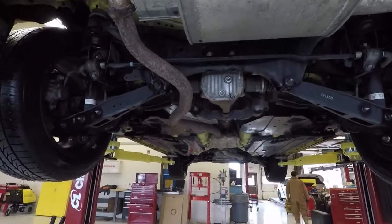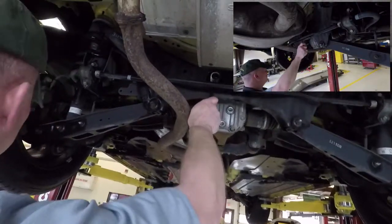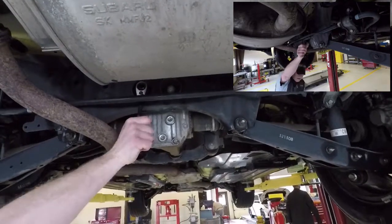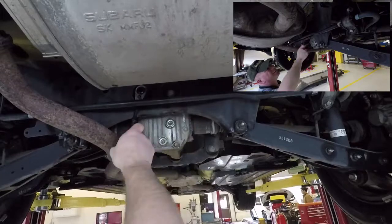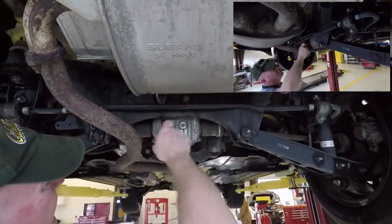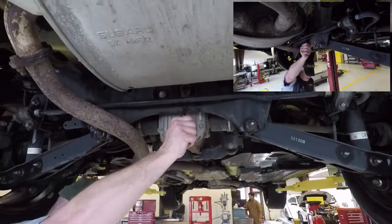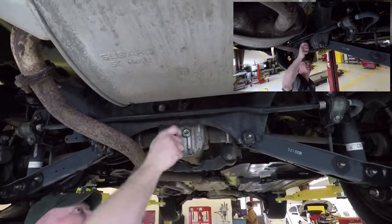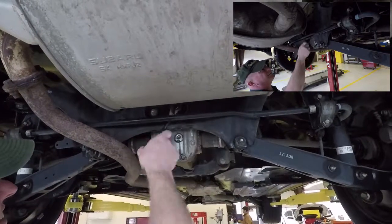To begin the install, there are two bolts that hold the differential. These nuts just get removed or loosened enough to allow the skid plate to be slid up. There are two slots on the top of the skid plate — they'll just go over the bolts that stick out, and then you just tighten it back down. I'm loosening them up and checking for space.